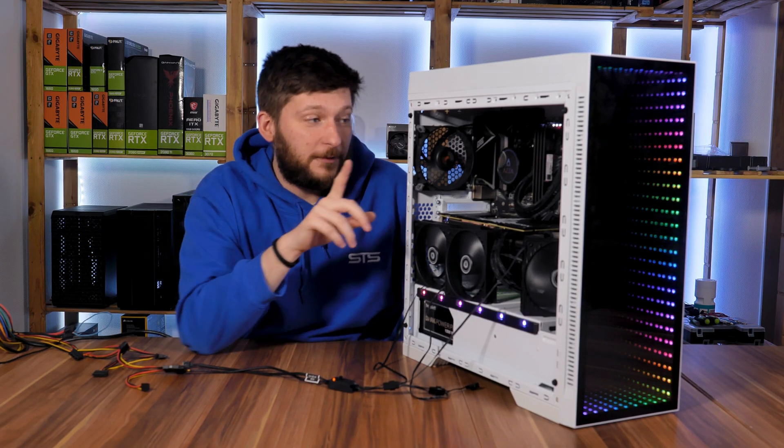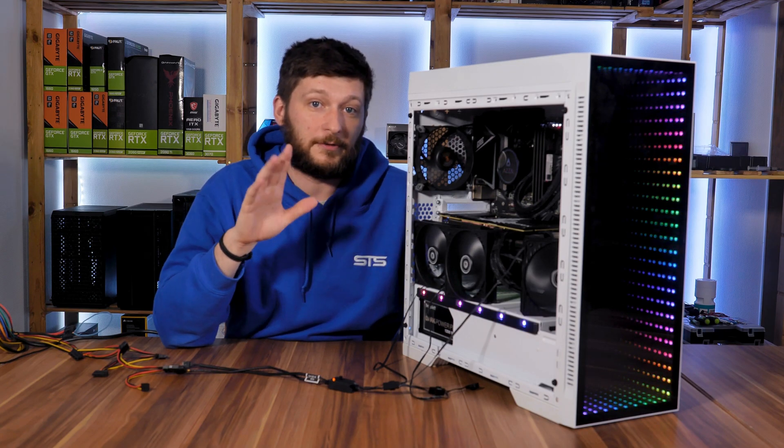I tested this in the morning and it actually works. To prove it, let's look at what happens if I turn the fans back off again. I just wrapped up the review of the Intertech C701 Panorama, which has bottom intake. It kind of annoys me that I lose the front USB-C, but I get cold air intake for the GPU and way better air intake for the CPU. In the end, I might solve two problems with one simple solution — and maybe I'll even get the i9 to 5 GHz.